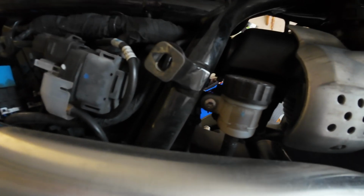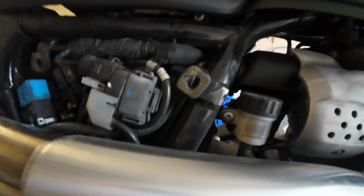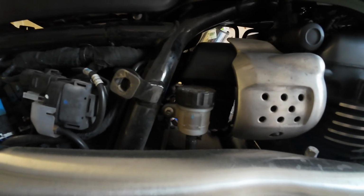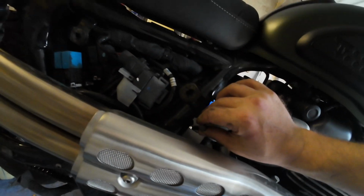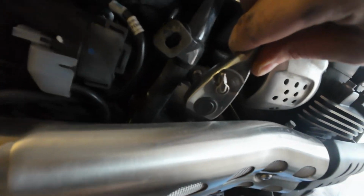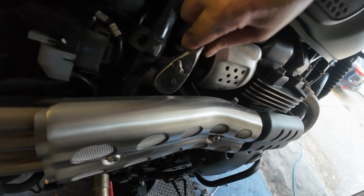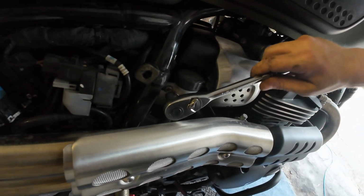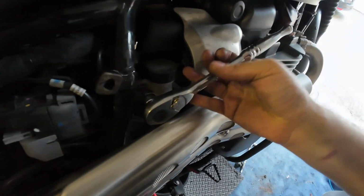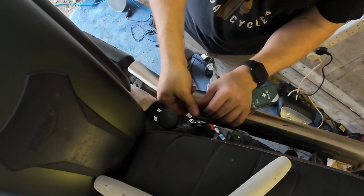But yeah, getting to this bolt here is going to be the toughest one. So for that, we need a Torx 30, I'm going to guess. T30. Oh, what a guess. First try. Oh, there's not much clearance between them. If that's going to get as small as this undoes. Why is that getting tighter? Yeah, that is getting tighter. It's probably got a build-up of crap behind it. Yeah, there we go.